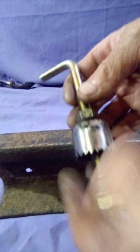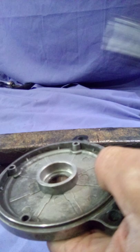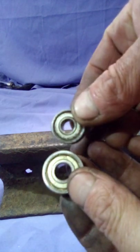I have a slideshow coming up guys. I actually made this puller — it's a bearing puller. You undo this, and say you were trying to get a bearing out of here — undo that, that goes through, you do up the nut on the other end, then you just wind it all together, wind it down, and then wind this out, and then the bearing just pops out. So we got the bearing out. It runs a bigger one on the front and a smaller one on the back — the one that takes the sprocket is the bigger one. That's the two sizes, they don't look far different from each other.